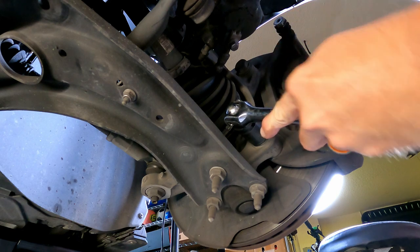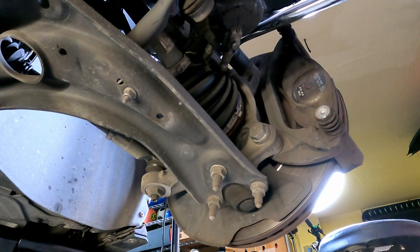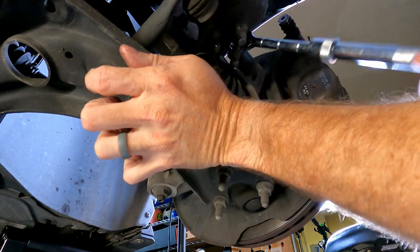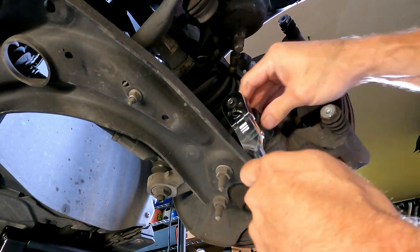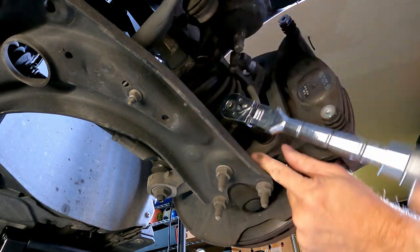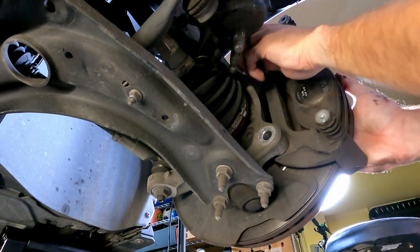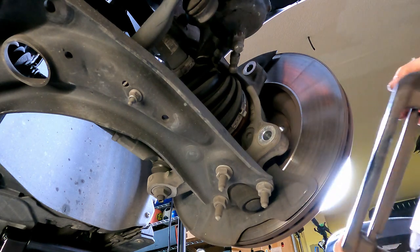The bolts on the bracket are pretty heavily torqued, so I need a breaker bar to knock them loose. These are reusable as long as they're clean and in good shape. Once I break the initial torque, I can use a regular ratchet. When taking them out, I leave the top one partially in so the caliper doesn't flop on the floor while I unscrew the last bolt — a little more controlled disassembly. This view is from underneath the front of the car. The caliper comes out with the pads right in it, and you just squeeze the pads to pop them out of their channels.